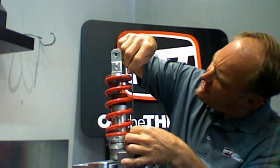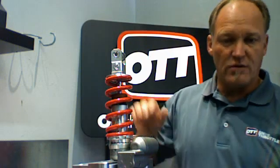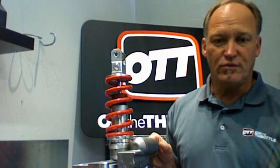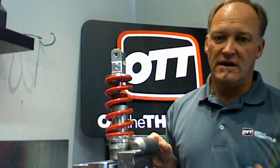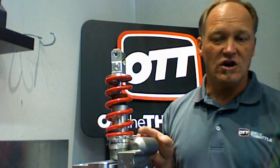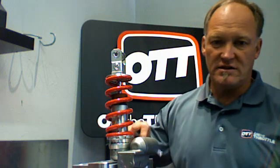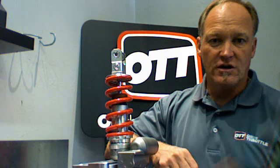We're looking at 150 millimeters, which gives us a spring compressed by 14 millimeters. In general, installed preload — whether it's a fork spring or a shock spring — is between 8 and 15 millimeters. High install preload numbers are generally due to a softer spring, or internally, a top-out spring. We have 14 millimeters of installed preload at the lowest possible setting on the preload adjuster, so it's within range.